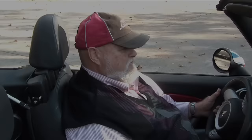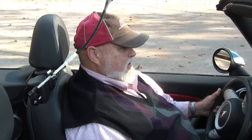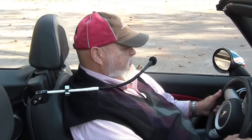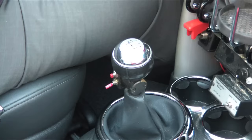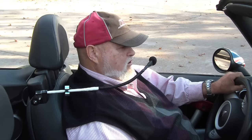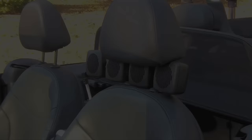I'm going to flip the switch on this block to the microphone position and push the button on the rocker switch for the microphone. When I do that, you'll see the microphone coming around into the picture to be used to talk on. Now when it settles in position, you have a microphone and can talk on your radio without taking your hands off the steering wheel. You can use the buttons on the gear shift for push-to-talk, or if you need both hands on the wheel, use the switch on the gear shift. When you want to put the microphone back, just push the rocker arm back up and it puts the microphone back into the back seat, out of the way.